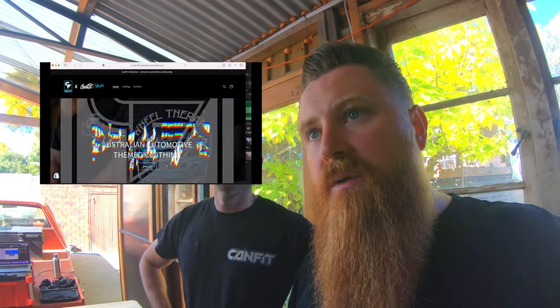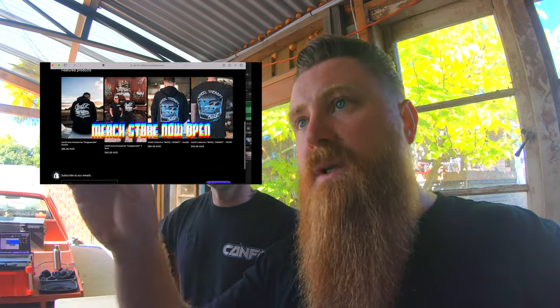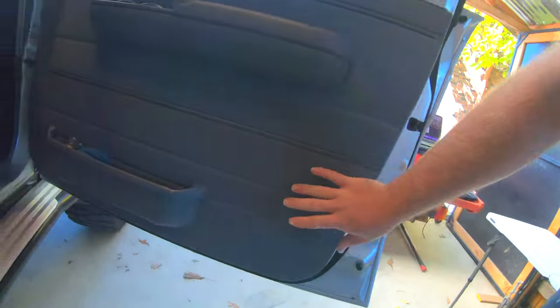We're gonna do a full package of this Car Builders sound deadener, which will be under the floor, two layers, in the doors, in the roof, everywhere. An aftermarket unit's already been fitted. That's not working very well for this customer, so we've got an Alpine unit to replace that. Alpine make these beautiful molded door panels that run a 6x9 speaker in them front and rear. So that means we have to run all wiring and everything because none of that's there.